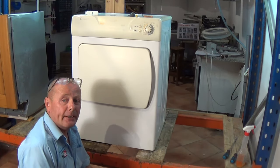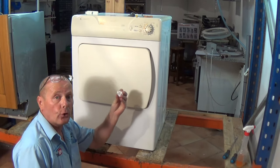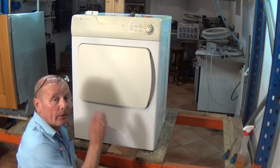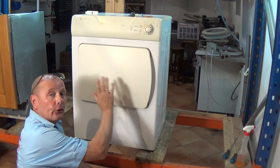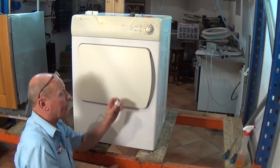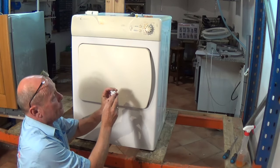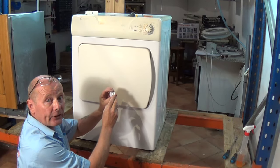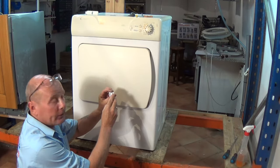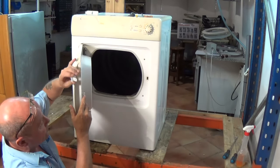Hi, welcome to How to Repair. In this video I'm going to be showing you how to change a latch or catch on a tumble dryer. These can be fitted to square door machines and also round door machines. The actual locking mechanism is exactly the same. What actually happens is with these, over a period of time, either due to the plastic getting hard and becoming brittle or people forcing the door, the actual latch itself breaks.